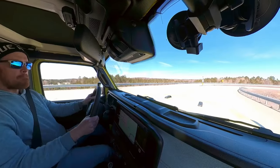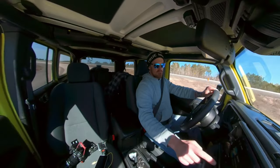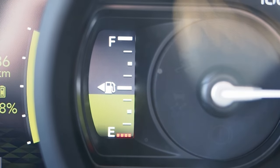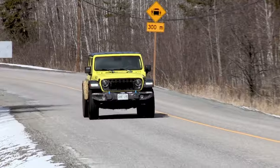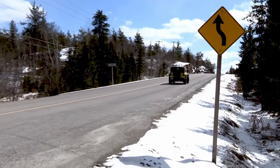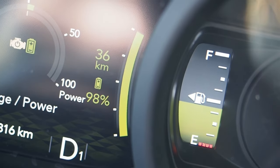When you do plug this in to recharge the battery — which is an overnight job on a 120-volt standard household outlet or just a couple of hours with a level 2 charger — you can store enough electricity to handle 30 to 40 kilometers of driving before the fuel pump even has to turn on. I really appreciated this doing my daily round-trip to the gym at about 20 kilometers using no gas, or a 27-kilometer round-trip for shopping — also no gas required. Just running out to pick up some shawarma for dinner? Same thing — gas gauge doesn't move. Shorter drives stop using gasoline, and if you charge up at home and maybe at work too, your gas gauge stays parked on a lot of your drives, meaning a few trips to the gas station per year instead of per month.